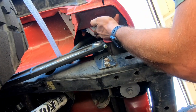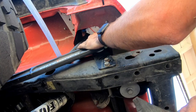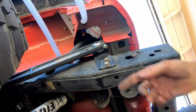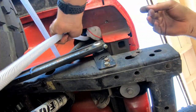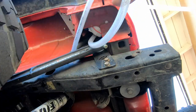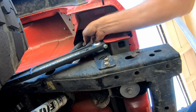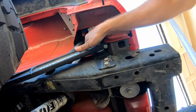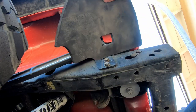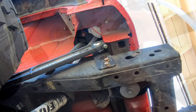In the rear of our Jeep you can see where our pump is, and these are some of our lines — our fuel filler line and some breather hoses. We're just going to take our water hose up where our pump is and then feed it out our tail light so we can work on it. I'll end up zip tying that into place, and then this is the piece of foam which normally goes in the bottom right there, and I'll end up replacing this before we finish up.